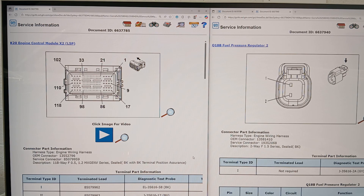But let's say we didn't have that result - maybe we tested it and we changed the duty cycle with the scan tool but we never saw the change on the DVOM, or we never saw the change in the intensity of the test light bulb.